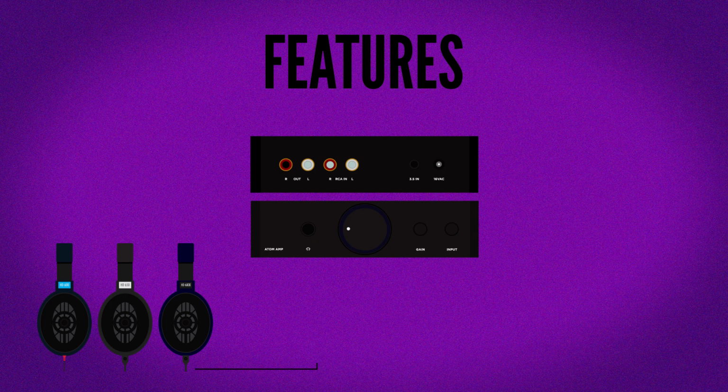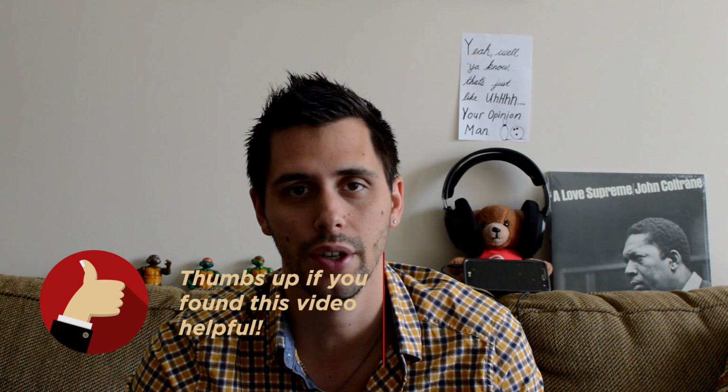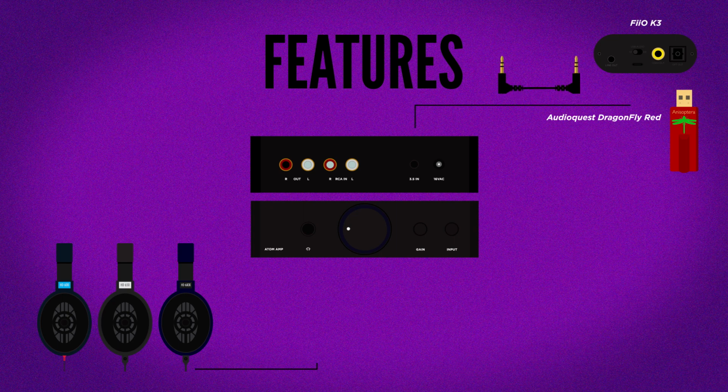Obviously you're going to want to use it with a separate DAC when you're listening to music, or else you're out of luck. The simplest and most effective way for me anyway right now, because I don't have a lot of wires and stuff, is just using a 3.5mm interconnect and plugging one end into a DAC and the other end into the Atom. So right now I'm using the FiiO K3. You can use the E10K as well because it has line out. Anything that has a 3.5mm line out you can use with this, a DAC that is, and even if it's an amp DAC you could still use it.